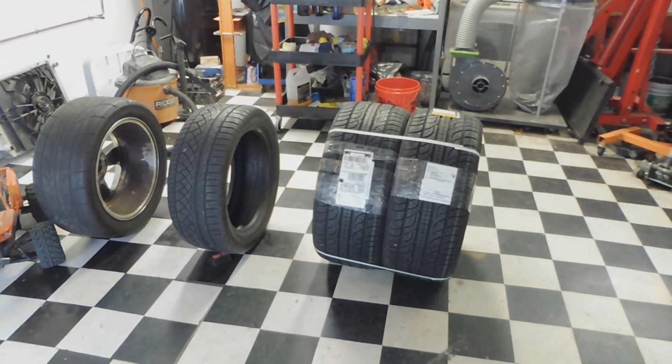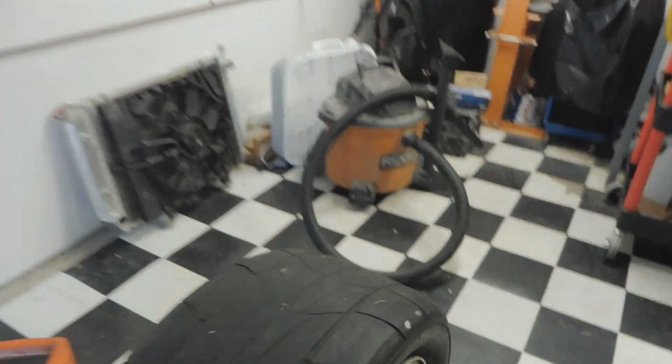So right now, the Scat Pack's my daily driver. I'm going to be going on a business trip, and I have bald tires, so we'll talk about that in a second. I really want to burn them up racing, incredible Hemi. That sucks. I guess I'll be using my brand new seasonal tires. Oh well. This business trip's going to be probably 5 hours, and I don't want to take any type of risk with my tires. They're not bald, but they're actually at the wear mark. A wear mark being, right here is a wear mark. As you can see, this is flush, which in theory for a street tire would be toast.